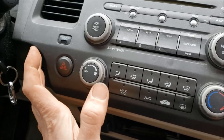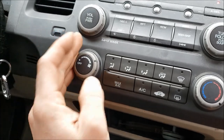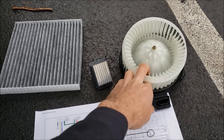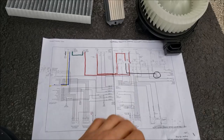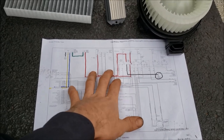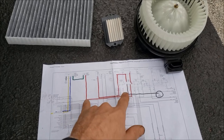KZGuy2 here again, no nonsense, no how. Today I'm working on this 2009 Honda Civic behind me. The complaint is, no matter what you set the blower fan switch on, the blower fan does not come on. In this brief video, I'm going to show you the steps I took to determine the blower fan was bad, how to replace the blower fan and the blower motor resistor, along with a new cabin filter. Toward the end of the video, we'll take a look at a wiring diagram and explain the system, so if your fan doesn't happen to be the problem, you have a better understanding and can pinpoint the cause. I'll try and keep this real fast — give it a thumbs up, and here we go.